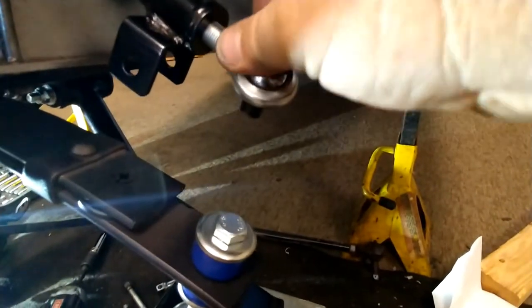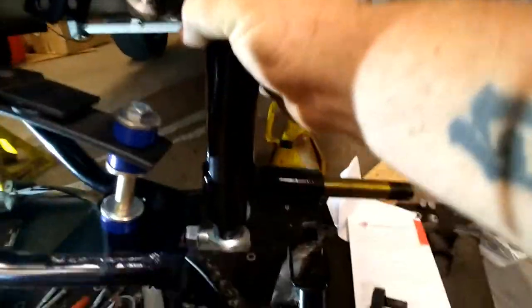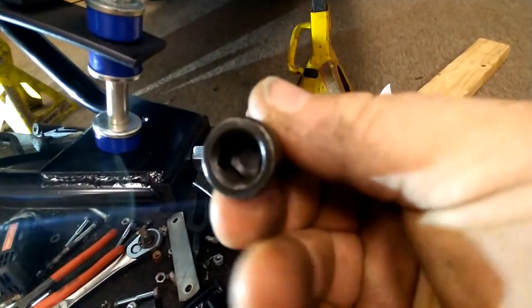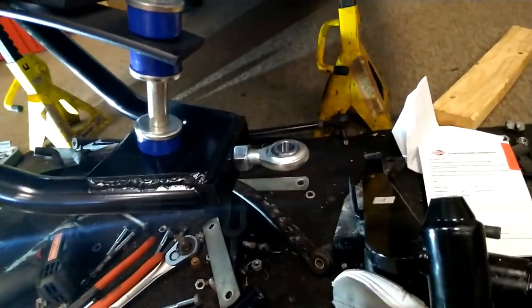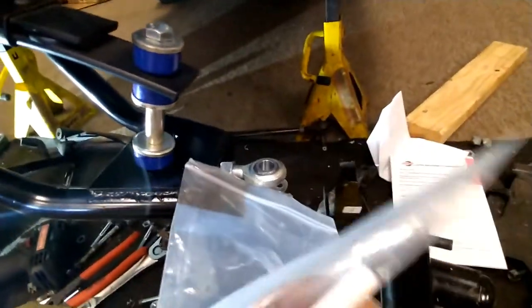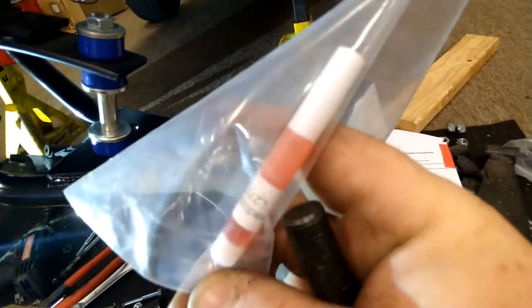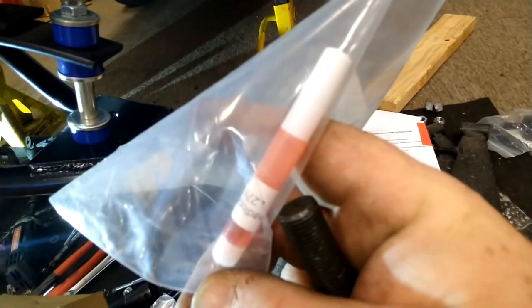What's really good about these particular lift kits is they're fully adjustable. Right now I'm not too particularly worried about the adjustment because we're going to have to fidget with that later anyway. They give you upper and lower torque bolts, and most of the kits — especially if you get a double A arm — they'll send some thread locker, so let's go ahead and apply that.